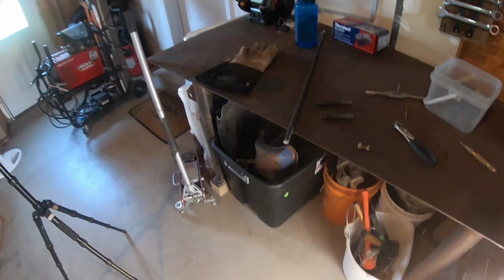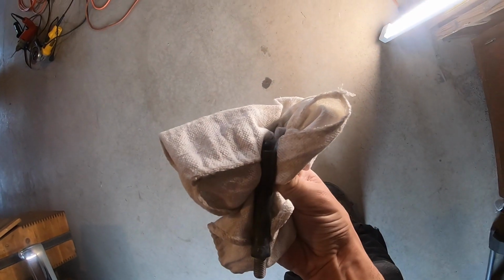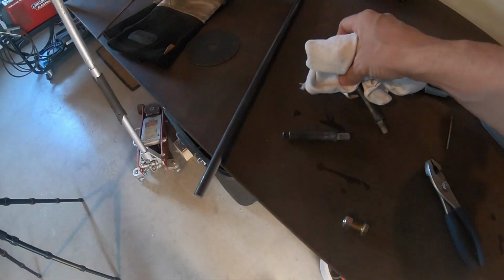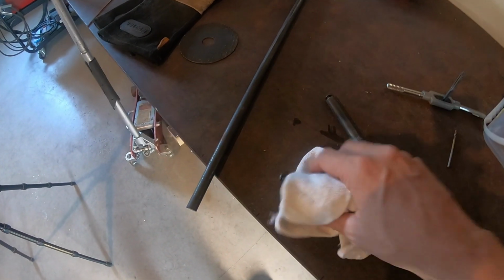So what I did is I took this 1/2 inch round stock. I tapped the end, welded a bolt onto this side. It can go through the frame, and I can run a nut. But I needed these little Allen heads on this side so that the box can sit up flush. And then I have to recess a little piece on the back side of the box so that it can butt up to the mount and not look all sloppy.